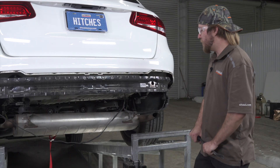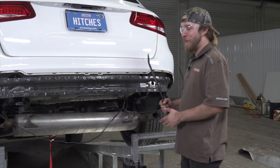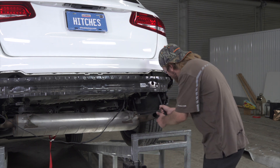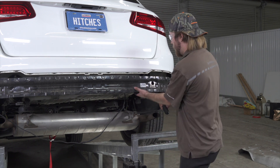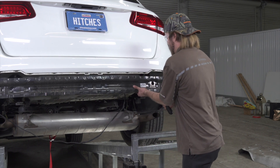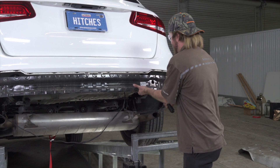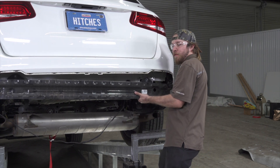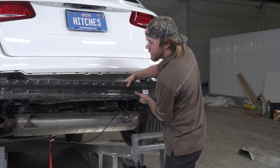Your bumper beam may be a little tight. To combat that, use a crowbar and just wedge it on one side and wiggle. That should loosen up both sides. If not, just repeat the same process on the other side.